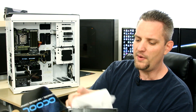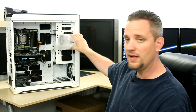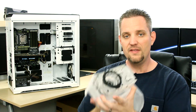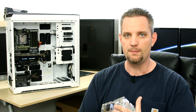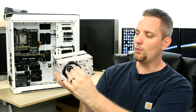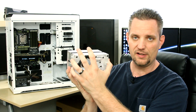Reservoirs — we're not going with a tubular res, we're going with a bay res. A bay res basically sits right here in the drive bay. The cool thing about AlphaCool kits is they have an integrated pump mount in the back. The D5 pump — which is, in my opinion, one of the best pumps you can get on the market — is a Laing pump, actually an industrial pump basically mated to work for PCs. It's going to mount right here in the back. So your pump and res is a singular combo, which is the most important loop order consideration.